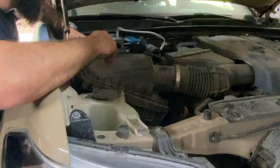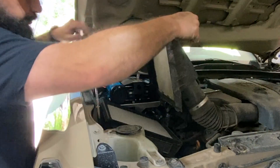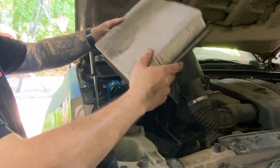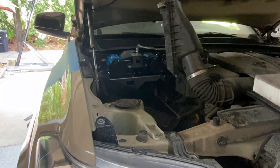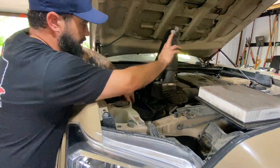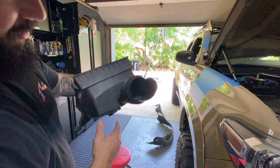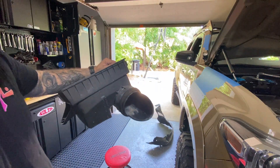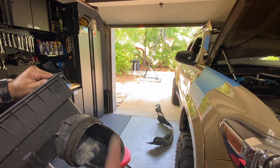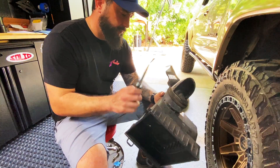I'm going to pop open the air box and get it up and out of the way. I could probably use a new filter too. With the air box off, you can take a good look — the entire suction is hanging outside of the engine, and that's where all the dirt and water gets in. That's why we're doing this. I'd rather have the intake a little higher and make water a little harder to get in there.